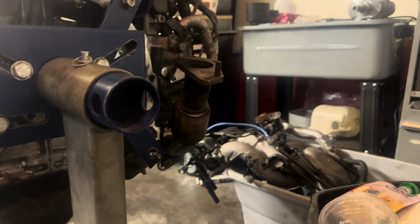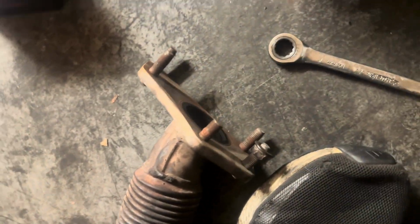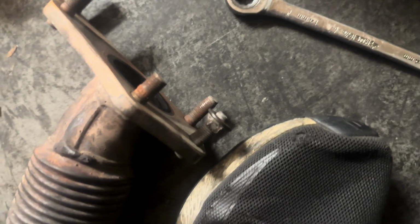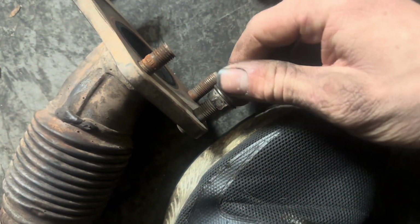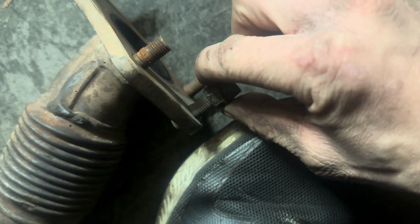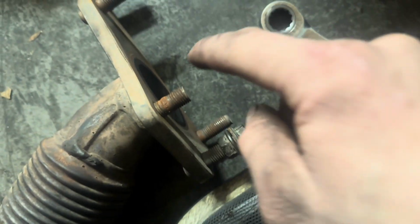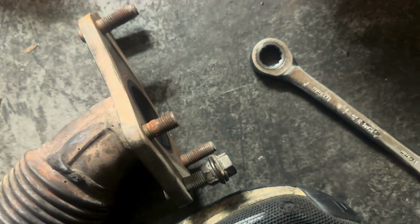Alright, air pump deletes are on for these heads, and then this up pipe I'm just swapping over the studs. So this is the old one, pulling off this stud, and this stud, and probably this back one. I'm just using the double nut method, so you put one nut upside down and one on top. This has to be farther down, and then I will tighten them together, and then loosen this one, and it should pull the stud out.